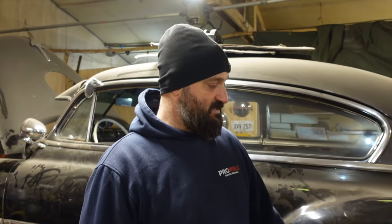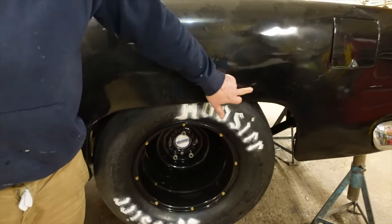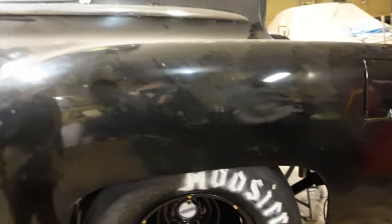It's not something we wanted to do, but at the end of the day it's just a small cut and a couple of pieces of plate. We're going to paint these quarters anyway, because when we cut those original wheel tubs out with the plasma cutter, it heated up the paint a little bit. So we'll just get the DA out, take that paint off, square it all up, blow the rear guards in, and just put a clear coat over it. Lots of hurdles along the way, but we've overcome them all. Suspension and rear end is pretty much done.